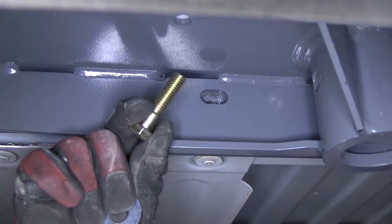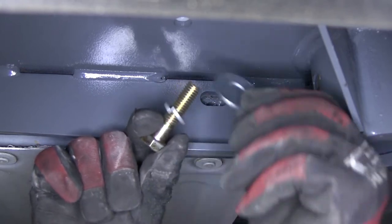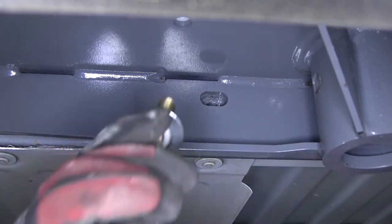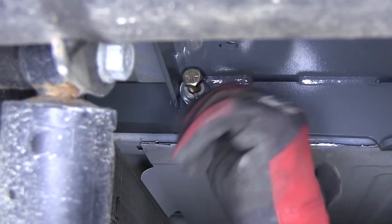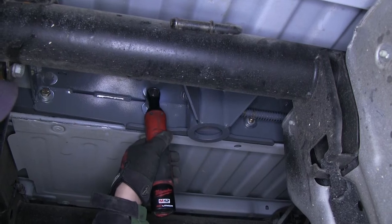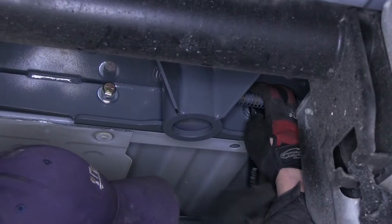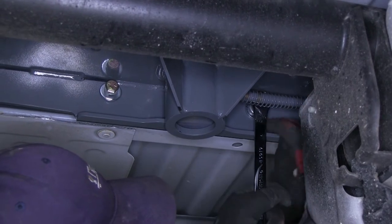On our rear rail, we'll use a two-inch bolt, split-lock washer, flat washer through the gooseneck head into the pre-threaded holes of the rear rail. Note there'll be four on the front and four on the back. Now with all those installed, I'll quickly go ahead and tighten them down, leaving them slightly loose and movable as necessary, but taking up some of the slack from our hardware.